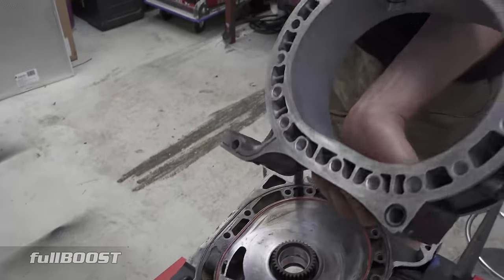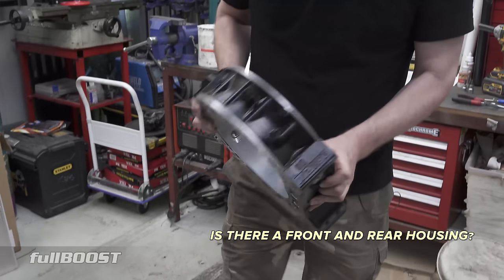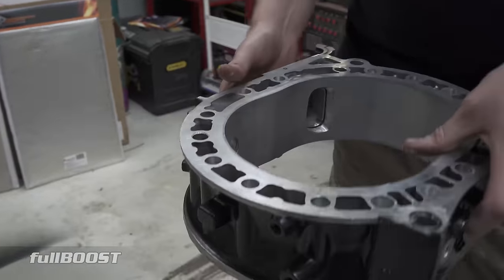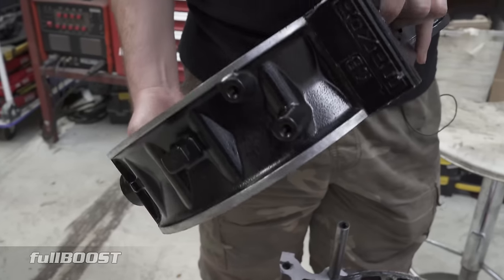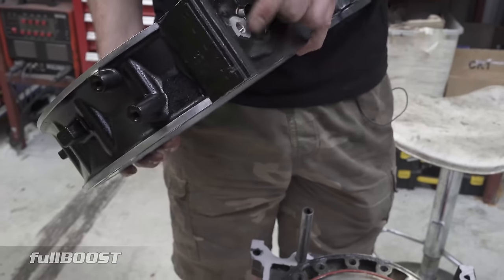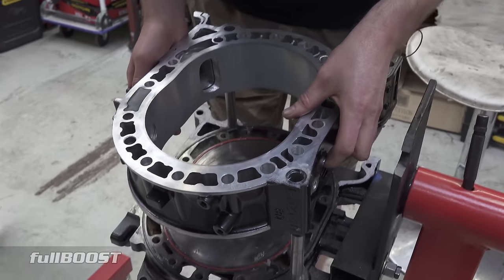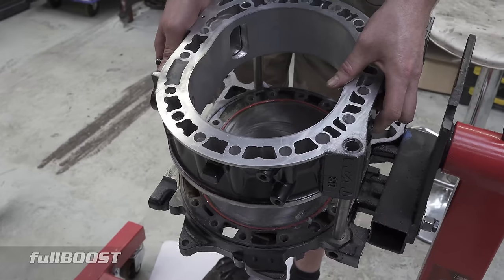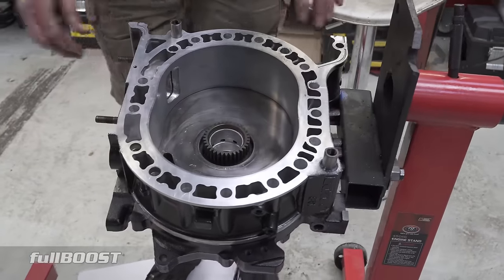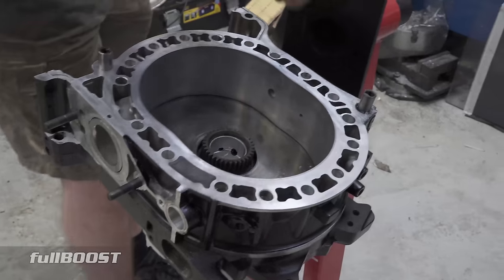We've assembled our O-rings in the housing — one on either side, which seals around the O-ring surface. Is there a front and rear housing? I see that written a lot online. Yeah, these have F and R stamped on them, but not really — it won't really make too much of a difference for most 13B engines. For the most part it won't really matter if you get an F or an R. I believe Project Redline originally had two rear housings on it. Down we go and in place. I'll get the other dowel and put that in there — these are an interference fit and are meant to be tight.